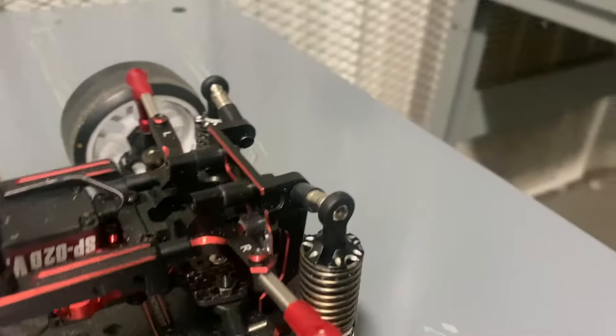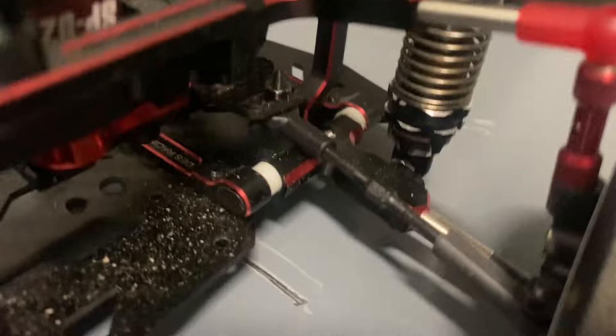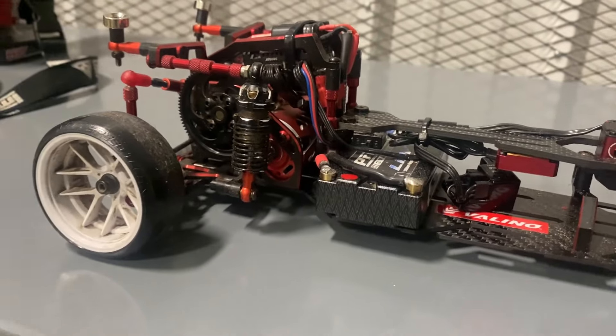If you have the tuner for your servo, you save a lot of money and weight doing this, and you get more precise Ackerman. Mine is suited for how I like to do things — minimal toe out as well. The direct drive is not a Yokomo conversion; it is straight up what I made on my own. I love it, I understand it, it's very simple. I also got rid of my bump steer.